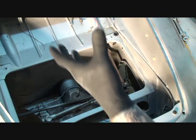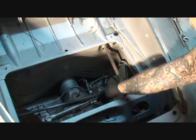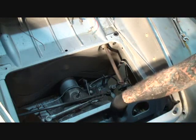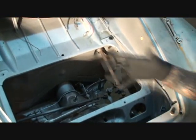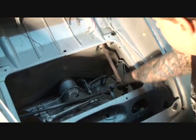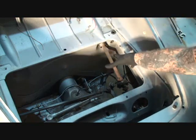What we're looking at here is the trunk area — this is where your gas tank would go. The first thing you want to do to remove the body is go ahead and remove your master cylinder. The master cylinder has already been removed; it sits right in this area and hooks up to this hose right here. The owner removed it before he took it to the sandblasters. Now we've got to remove the steering column from the steering box, due to the fact that the steering column is mounted on the body.